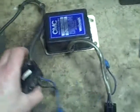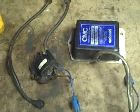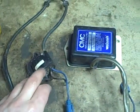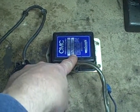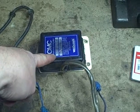Let me talk about this ignition system on this outboard. It's simple and complex at the same time. The actual main components of the ignition system are basically just this special ignition coil and this module right here called an amplifier assembly. What this actually is, is an early version of the CDI ignition.